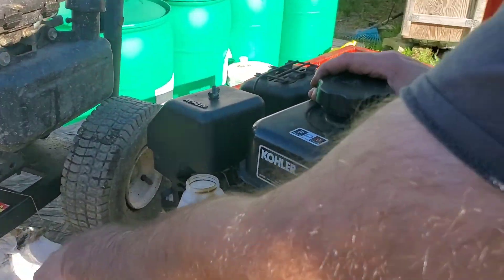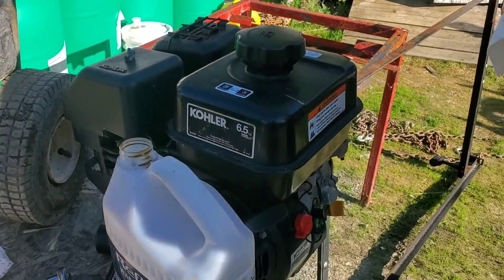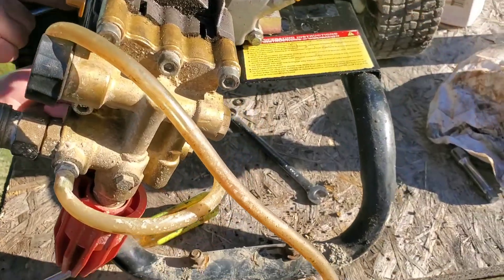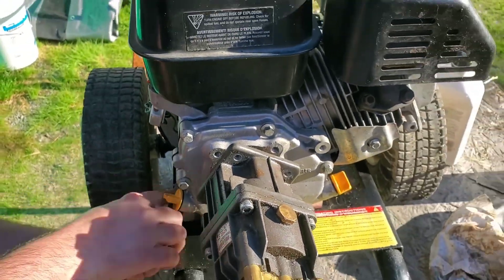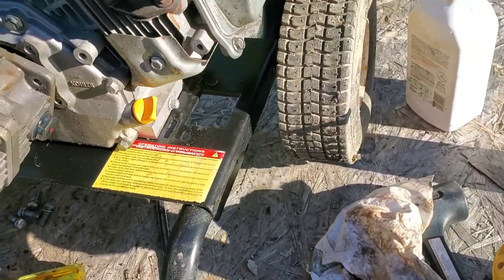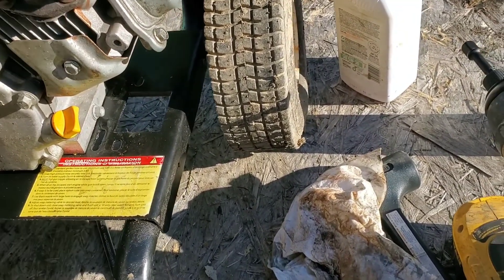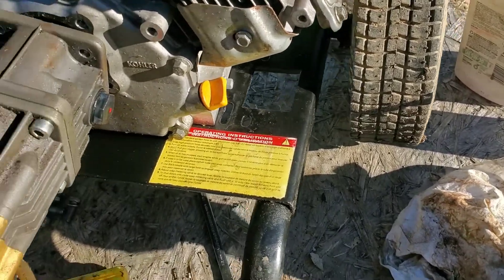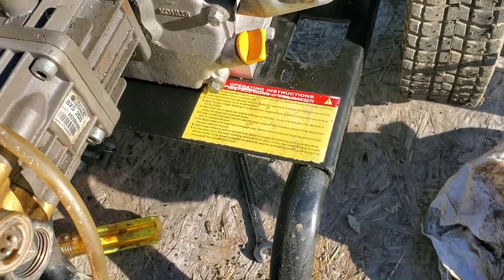So that's what we're taking — that little 4 horsepower Honda — and we're going to put this big Kohler motor on there. Hopefully everything lines up somewhat, hopefully the pattern for the pump and everything. Other than that it just sits on an open platform, the gas tank is up higher, everything should fit. Shouldn't be too bad. Now I've got to try to get the old drain plug out of there.